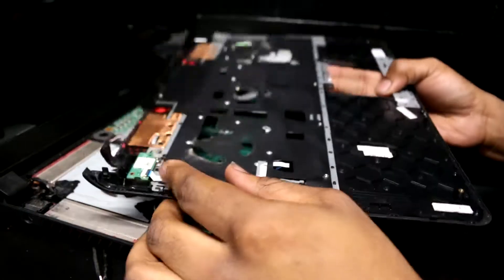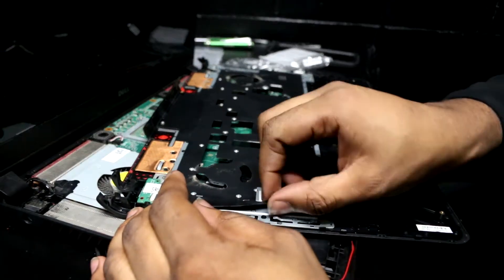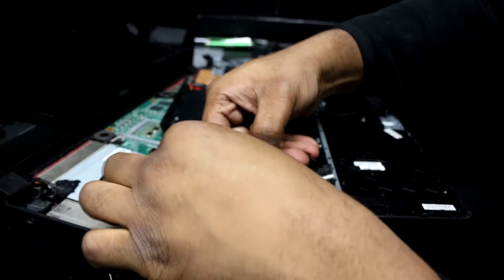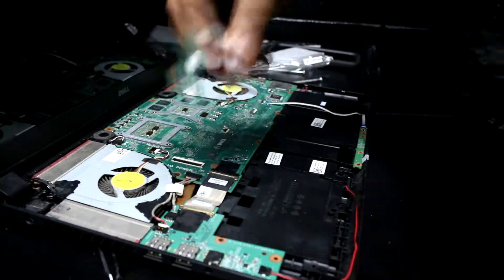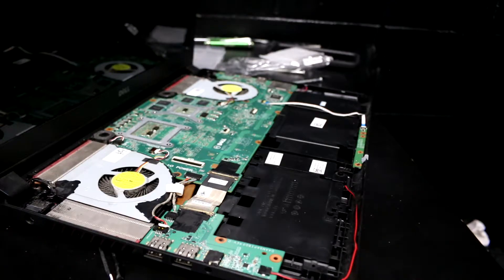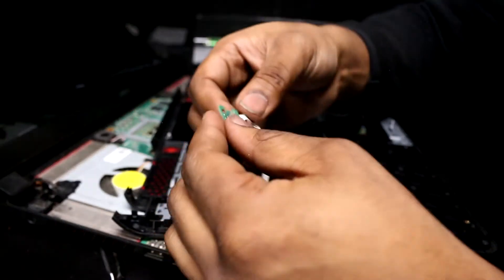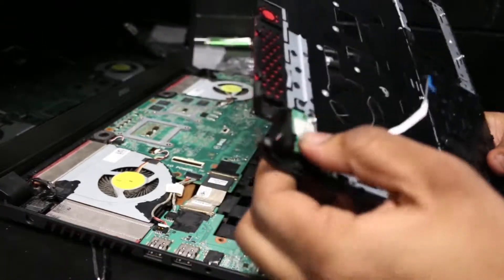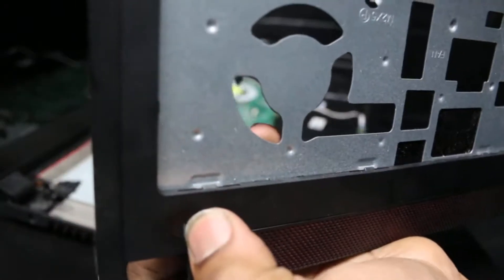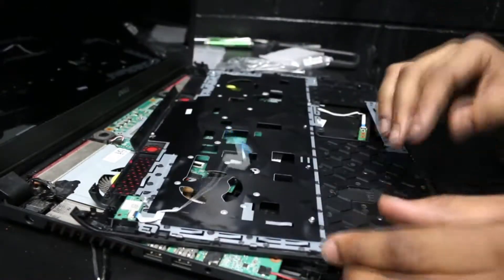The only way to do this is to remove the black tape — just peel this off a little bit. I'm pretty sure this board just pops right off, and so does the tape. Be very careful with this. Now we have to repeat the same step on the new touchpad. Once you click the button and hear it clicking, that's how you know it's in position. I didn't hear that click before, so that alone makes me happy.